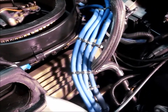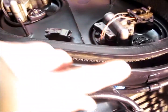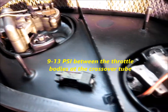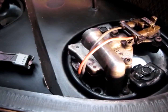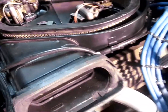The whole car is electrical, so a lot of people look at fuel. But if you have 12 PSI in your crossover tube between your two throttle bodies and you've got a nice cone-shaped spray pattern on your fuel injectors, that's pretty easy to see — the rest of it is going to be electrical. Make sure when you put this base on there, you don't pinch these wires; that's really a problem with these things.